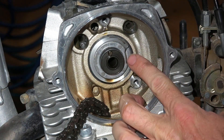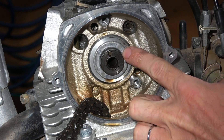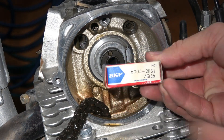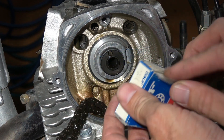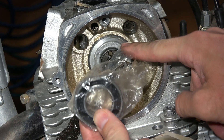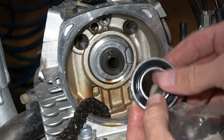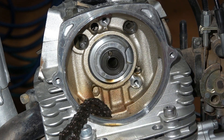This is the journal bearing — in the Yamaha parts fiche it's called a collar. This is what's going to be replaced with a 6005 bearing. I got an SKF brand 6005 bearing that happens to be the exact same size — the ID, OD, and width — as this collar. I'm also going to remove both seals because I don't think this rubber is up to the temperature duties of going into a cylinder head.